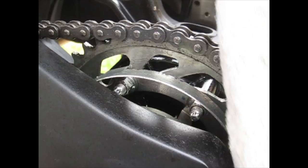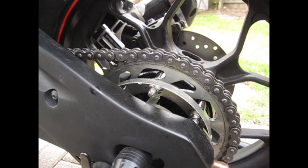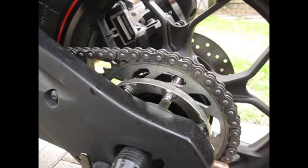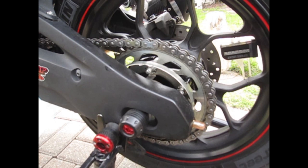When working on your chain and wiping it off with the towel, always go away from you — don't go towards yourself. That'll lessen your chances of having an accident, because if you go towards yourself with your hands near the chain and sprocket, you're going to get pinched. Always work from the back and always go away. Now that you're done wiping off the excess, spin the wheel and you'll notice your chain and wheel should move a lot more freely because now there's no grime or grease binding and causing friction. If you found this video helpful, please like, subscribe, and leave any comments below. Stay tuned for bonus footage on how to get rid of the tackiness from your swing arm.